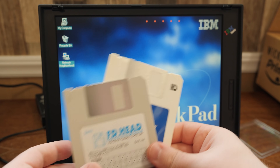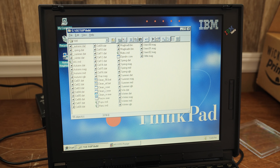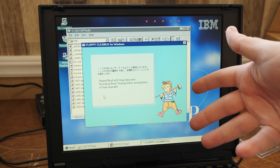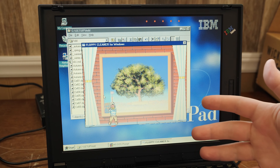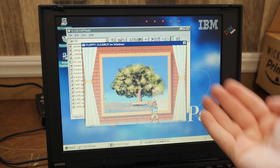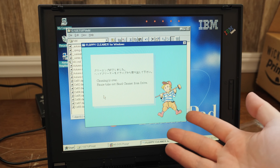The other final question was: do you run this off a hard disk? Maybe if you run it from a hard drive, you can just have a real cleaning diskette in the floppy drive — maybe then it'll work. Let's try. Same thing — I have everything copied over to the hard disk and you get the exact same thing. It's not going to load anything from the floppy drive. It's not even looking, not accessing it whatsoever. I've tried this several times, restarted Windows, gone into pure DOS mode, tried it on the other system — the Megalumina Monster — same exact results. Running it in DOSBox gets the same results even. It will not access the floppy drive if you run the program from the hard drive. And if you run it from a second floppy drive, it won't access the other floppy drive. I think that's most of the bases covered. It's just an animation and a set of sound files — got some MIDI for each of the Four Seasons songs.